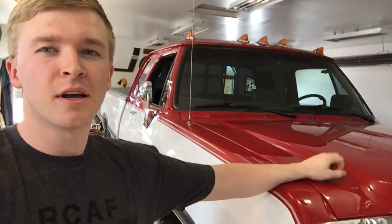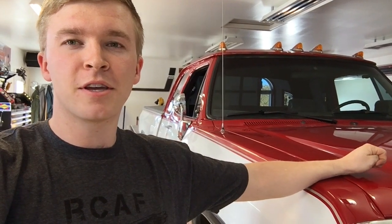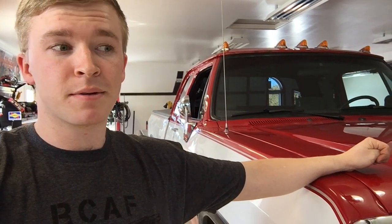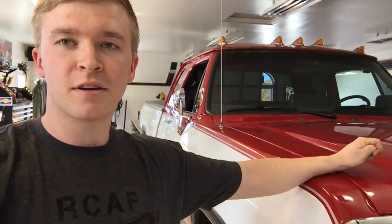I went for a test drive to test out the new brake booster — everything seemed to work pretty well. The braking was strong for vacuum booster brakes and it was holding vacuum. The only issue was some pulling to the right under braking, so I jacked up the truck and checked the wheel bearings and calipers, which seemed okay. I may rotate the tires first to see if that's the issue. Other than that, the brake booster issue is fixed. Hopefully that helps if you're looking to replace your brake booster or having stiff brake pedal problems — thanks for watching!